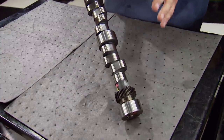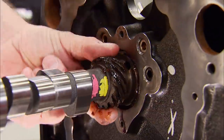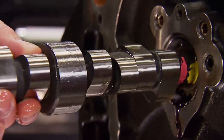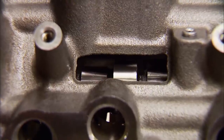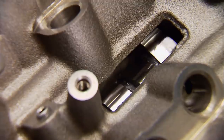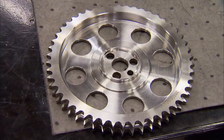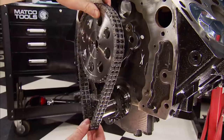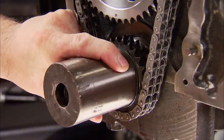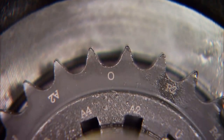The other major upgrade we're taking care of is the camshaft — a hydraulic roller from Lunati's Voodoo line. It's geared towards serious street engines that have at least a 10.5 to 1 compression ratio and use a 3200 or larger stall converter. It's also a great candidate for a nitrous setup, making it the perfect match for our Stealth 427. Lift at the valve with a 1.7 rocker arm is 625 thousandths on both intake and exhaust. Duration at 50 is 241/249 and has a 110-degree lobe separation angle. The RPM range is 2600 to 6200 RPM. The Gen 6 block has a cam thrust plate that locates the cam in the block so no button is needed to limit end play. Lunati also supplied a billet timing set that uses a Torrington bearing on the back of the cam gear to greatly reduce friction. It uses a double row chain and has a 9-position keyway crank gear. We'll install them straight up, meaning the intake and exhaust lobe centerline is 110 — not advanced or retarded.